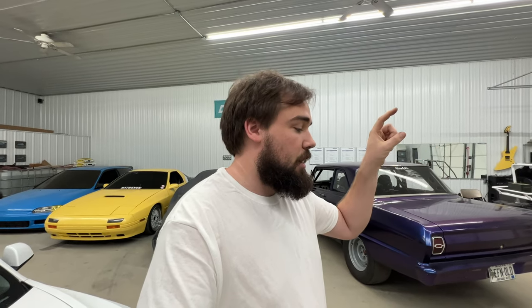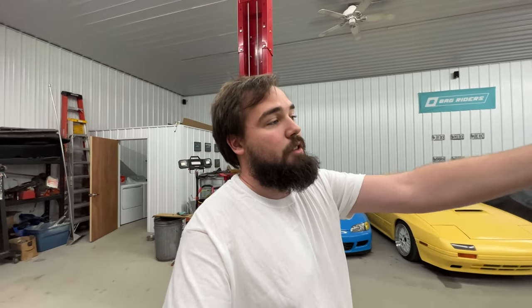So we're still staying with SDRs, but once you jump from an 8 to a 10, anything from the 10, 12, 15s, or 18s are a 600 RMS versus the 350 RMS that you find on the 8. A single 8 took up a quarter of my trunk space, and one half of the trunk space I do not want to give up, but the other half I'm completely fine with giving up. So rather than the single 8 or a single 10 taking up a quarter of the trunk, we might as well fill it all the way across. That's why we're doing a loaded enclosure with two 10s that'll take up the other half.